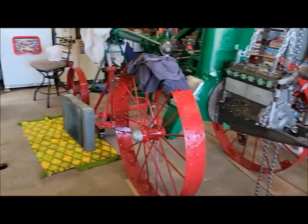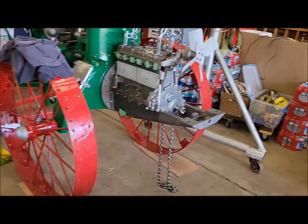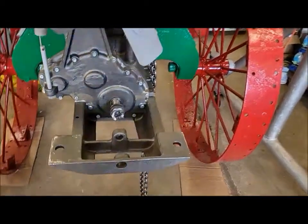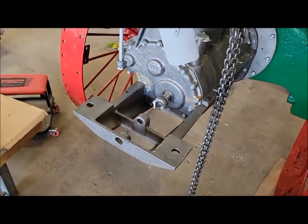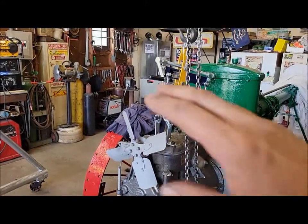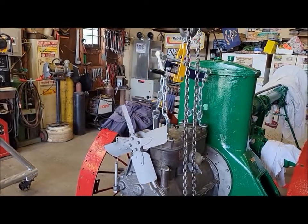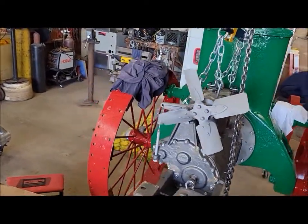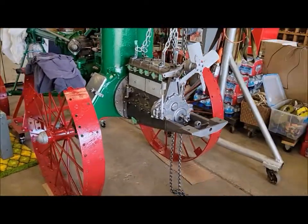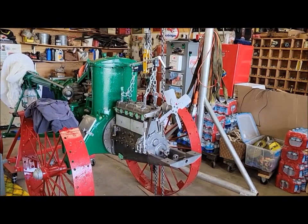One, like the radiator, figure out what length studs I need for that, and what type of bushings, and some rubber pads probably for here. What thickness those need to be so the hood lines up even. We can look at the hood and figure out holes for that. We can figure out where the hole for the exhaust comes through the hood, and there needs to be a ring around that hole, so we can fabricate that.